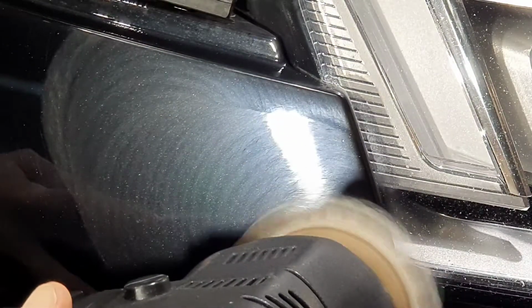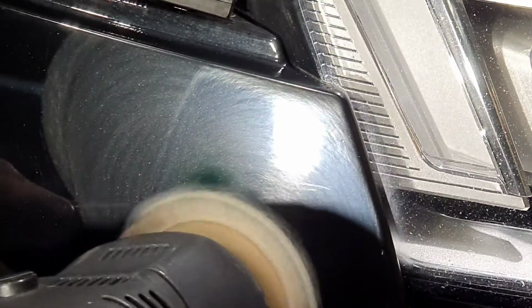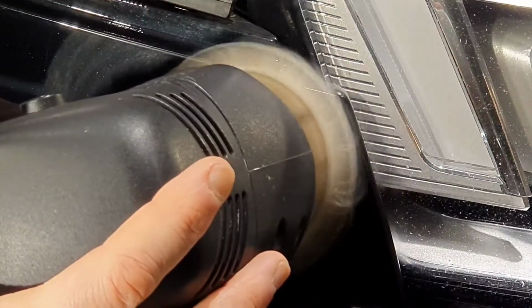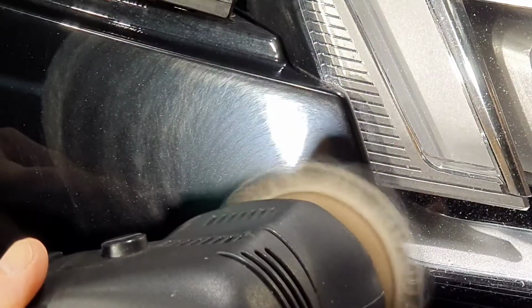As you can see, the sanding marks go all the way to the edges of the panels, which means I have to compound to the edges of the panels. Contrary to popular belief, this can be done very safely, but it does require constant monitoring. Shooting in real time proves that no edges were harmed in the making of this video.